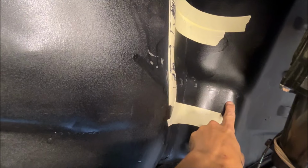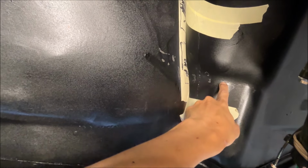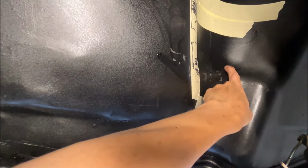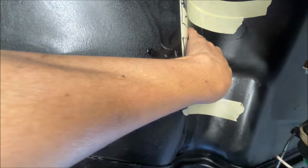If we're looking right here, I noticed something. This curves up. It's not just shadows of the light. It's a more definite curve, I would say. In other words, clearance curves up more. It's smoother here, which is part of where I need that clearance. I think what I was going to do was cut along here, a trapezoidal piece out, and then move it down. Then this curve up, imagine a cut line right where that radius stops. If I pulled that cut line back, about 2 to 2.5 inches, to here, then this clearance would make room for these top two bolts. And then it might help up here too, because that would pull this larger area back, and that might make enough room for up here.